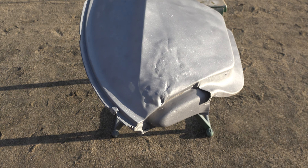This defect wasn't extreme enough to be noticed earlier, but now that everything was in primer, it was totally obvious. While I could have ignored this and hoped for the best, I was afraid that in the future there would be clearance issues with the hood, seeing that this is pointed inward. At the very least, it would have messed up the gapping between the fender and the hood. Ideally this should have been fixed by pushing the section back out, but I was afraid this could have messed up the bodywork on the outside, which at this point was looking pretty good. So my only option was just to beat the snot out of this section until it was straight.